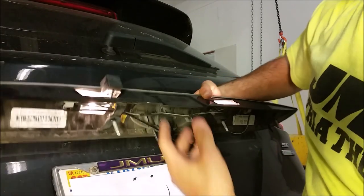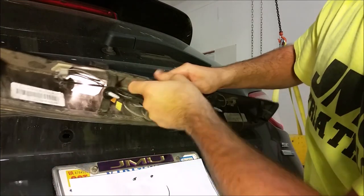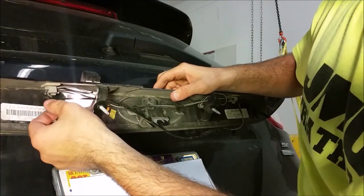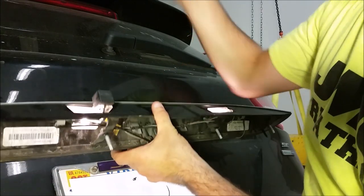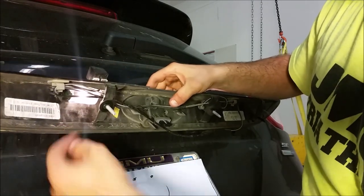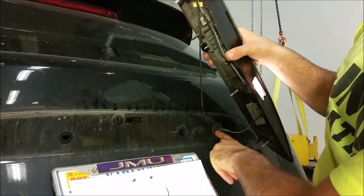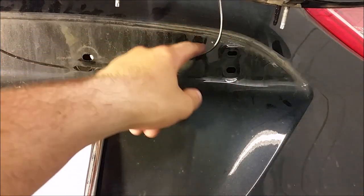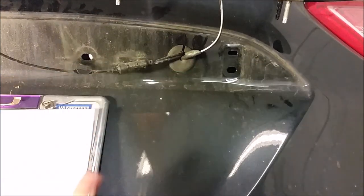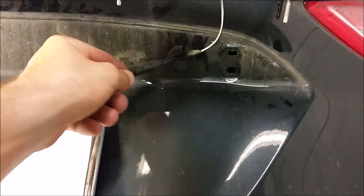Okay, so we have access to the back side of the plate light piece of trim. Now I have the camera installed here because I did this some time ago, but how I did it — the back side of the plate light, this is the normal housing that's stock. I unscrewed the light, turned it a half turn, popped it out backwards, then popped the housing out, put the camera in with the wires coming through the hole, put the light back in, then ran the wires through this stopper here. I reached in the back, popped out the stopper, took a razor blade and sliced right through so that I could put the wire in there as well.